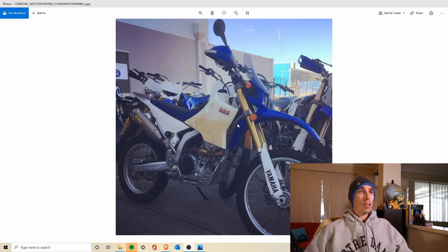You can see it's got the general crash protection and a radiator guard as well. It's also got a safari tank, which I've had before — very reliable in my experience. It means I can go straight out into the trails and have fun without getting fuel anxiety, as most of my day rides tend to be over 300 kilometres, so the stock tank just isn't up for that. I'll probably put an IMS on at some point because the safari isn't big enough for the big adventure trips. There's also a windscreen, and I'm really interested to see how that goes at highway speeds saving my chest from the buffeting wind.